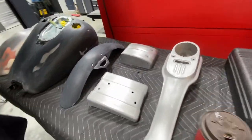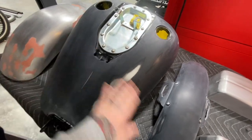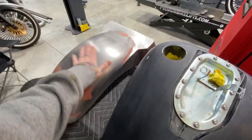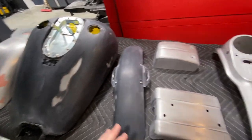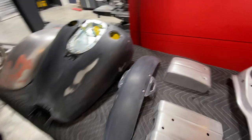Okay, now that I got all the parts sanded down to 220, got the clear coat off all the existing paint, got all the Bondo work done on the base of the fender. Next up, I'm gonna sand every other part down to 400, wax and degrease it, and then the next step is get this first coat of primer on. So as you saw yesterday, I got everything sanded down to 400. So ready to go. I'm gonna prime everything and then let that dry and see if we need to do any more Bondo or any wet sanding or anything.